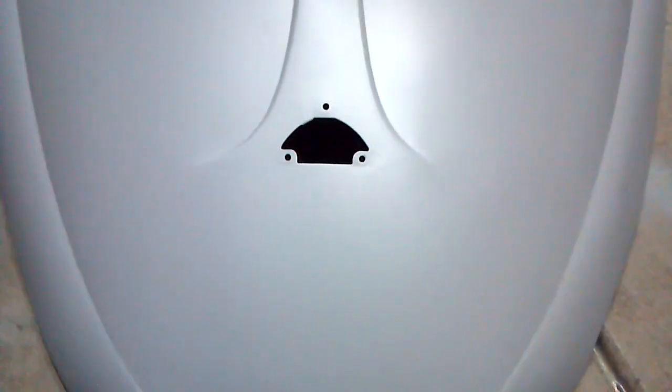Anyhow, I'll show you some of the spots that I still have to work out. I was hoping and praying that I wouldn't have to go this route, but as you can see, there are some spots right in here. There's a little divot that I'm going to have to work out, and for some reason I had spattering happen when I started spraying. I got some droplets that flew off of the tip somehow. I should have checked the tip before I started spraying again to make sure there weren't any boogers hanging on there, but I got some snot on the panel, so I'm going to have to work that out. And if I can get it to show up, there's a spot in here that's still got somewhat of a dent. Or this could even be just from using the wrong sanding tools to try to shape this area out.